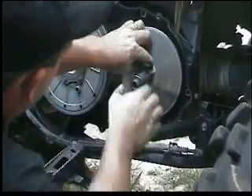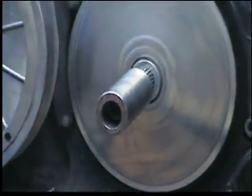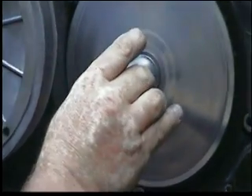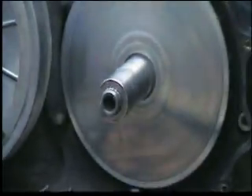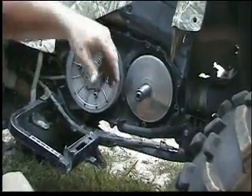I see a little bit of grease on there and I ain't liking that too much, so I'm going to try to wipe that off. The last thing I want is my belt slipping. Actually this ain't my bike, so it'd be my buddy's belt slipping — that'd be kind of funny, but he ain't here right now. The shims are on there. All this stuff has already been cleaned. You would want to clean all this before you put it all back together.